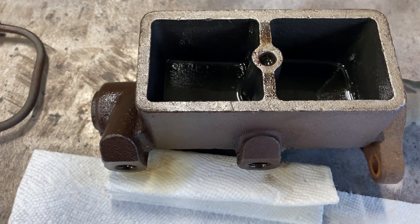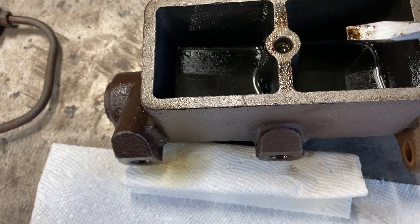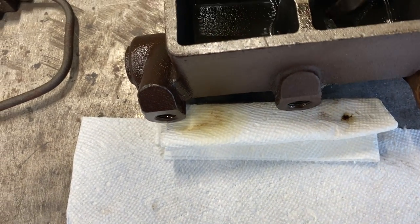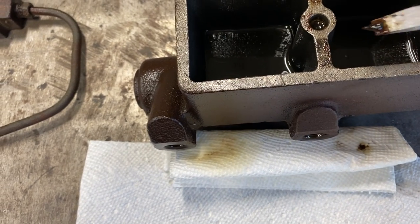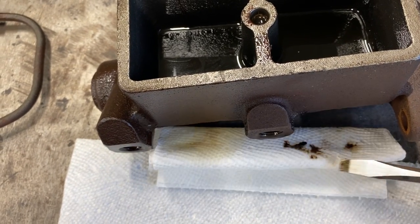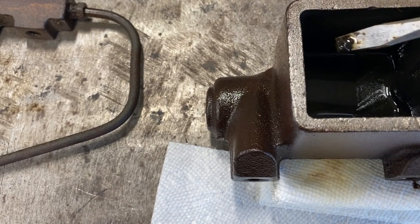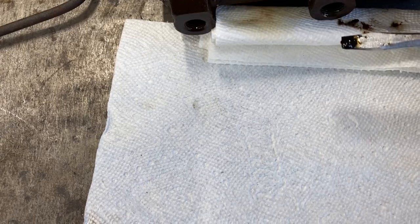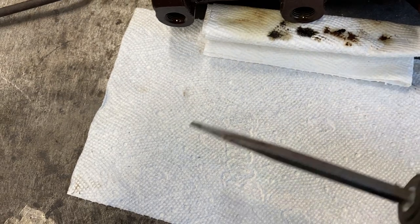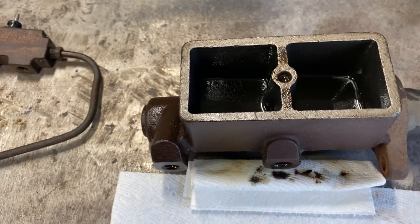Regardless, when a master cylinder has been on a long time, you get this mud down in the bottom. Yeah, look at that. I don't really know where that comes from. This is all supposed to be sealed up, and it is, but I see this not only in master cylinders but also in wheel cylinders. This is very hard to flush out, especially when it gets all the way in the back of the wheel cylinders. It causes all kinds of problems with the wheel cylinder pistons moving freely, and it's another reason to flush out your hydraulic system periodically.